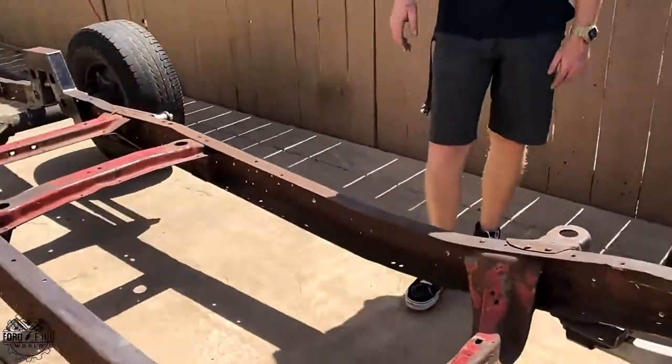For those who don't know, what are dimple die plates? It's a 3-inch hole, maybe 3.5, with a dimple die, basically like your cheeks, a little dimple that goes in. It pushes the metal in like a bowl, but it still has a hole in the center. What that does is triangulate the metal. It adds horizontal structure instead of just vertical structure. Since you cut that hole, you have weight savings, and you can use thinner material, because a triangulated piece of 1/8-inch steel is almost as strong as a straight piece of 3/16. So they're almost even in structure, and it saves a lot of weight.